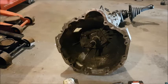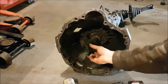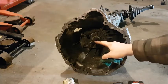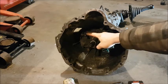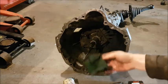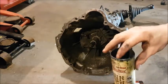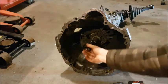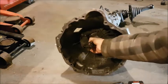To give the transmission a quick clean up, there's two things I like to do. First, I have some Scotch-Brite — this is the green stuff, but the red stuff works better arguably — and I like to use this to remove all the rust off of the input shaft, the throw-out bearing collar, and the little pivot ball for the clutch fork. I've already done this off camera, but when that's done I like to re-grease all those components using some high-temperature grease. Just put it on — it should be a very light coat. This is just to make sure everything goes together smoothly and operates perfectly.